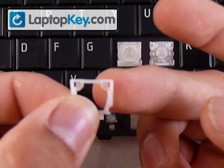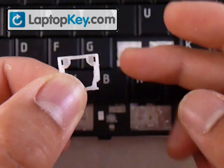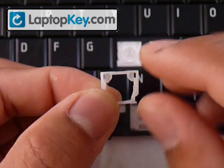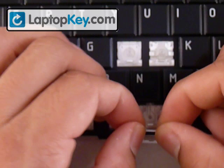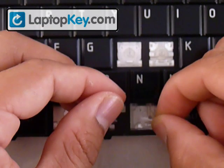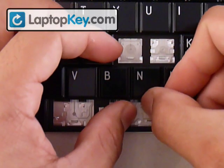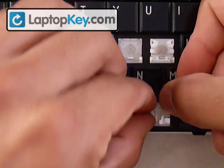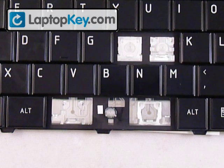You want to determine the position by feeling the corners where the holes are. If you feel that wall of plastic, that face is toward the keyboard, and on top it's supposed to be the gap for the next piece to go on top. So insert the bottom bar of this piece underneath the large hook first, then push the whole piece up in order for the top hooks to grab onto the rectangle holes.